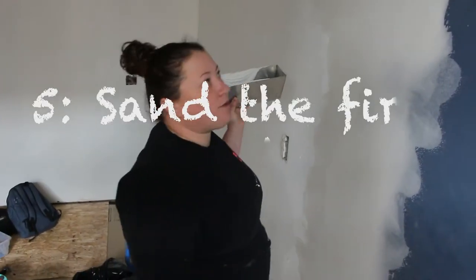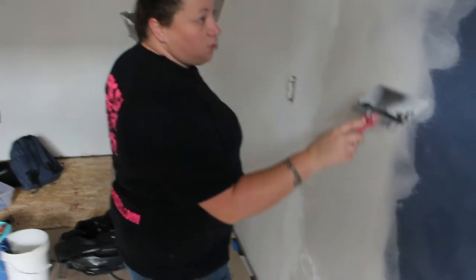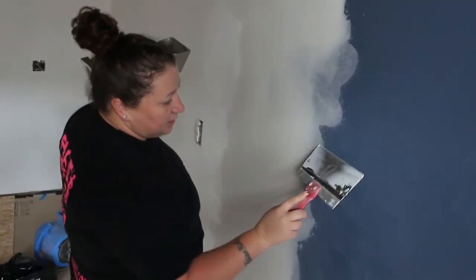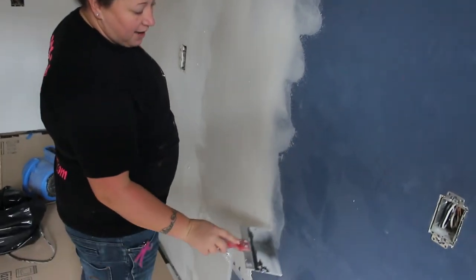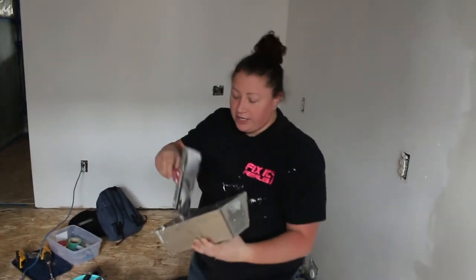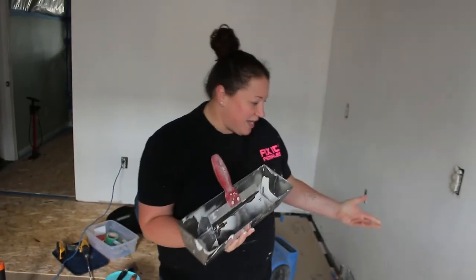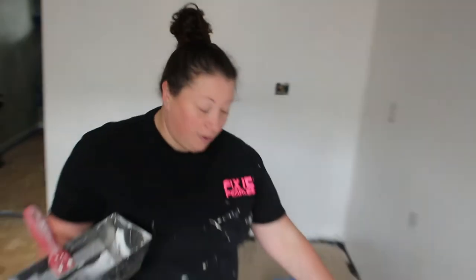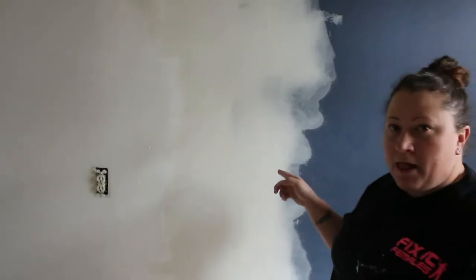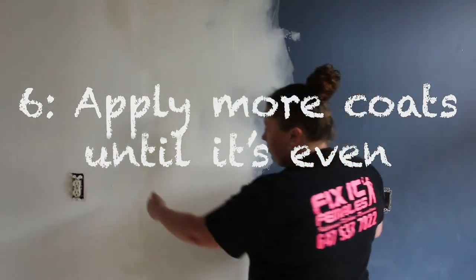Once this dries — which will take a little while because it's thicker — you'll sand it down and add another coat. On the feathered edge — I call this the tapered edge — you want to make sure you see a little bit of a light ridge there, because if it's prominent, those divots will cause problems later when you're trying to sand. I've been doing this for 17 years, so when I look at this I think I'll need probably another two or three layers at the bottom in this section.